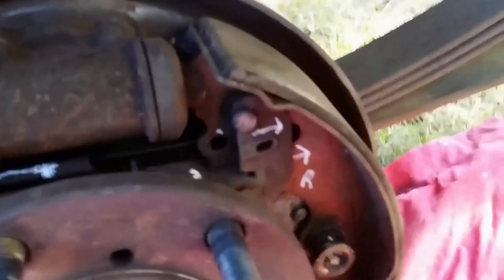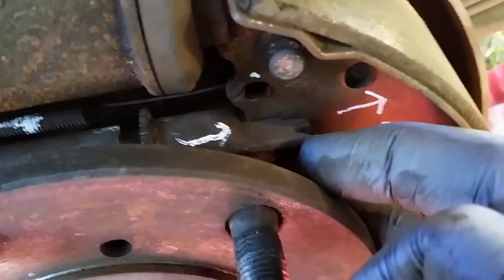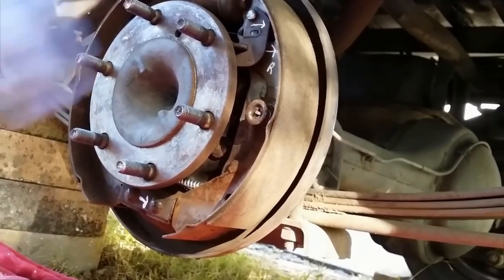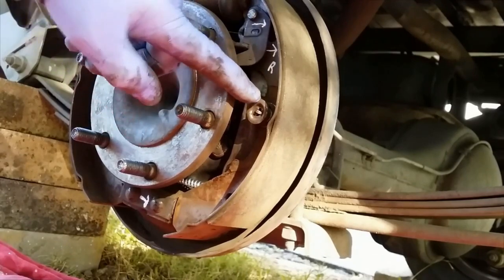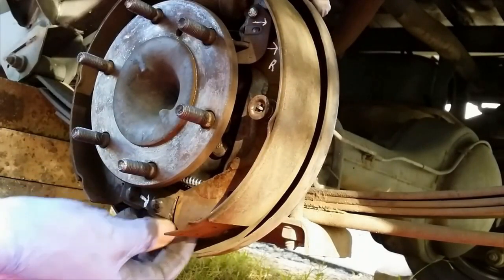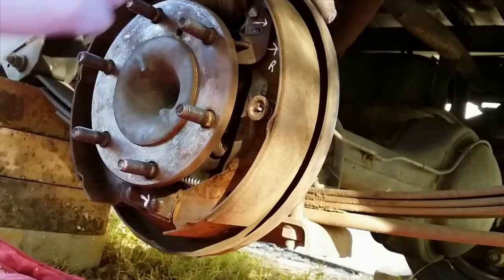With this small adjusting lever, you can just remove that. With this spacer, there has to be a notch facing out — that's what the spacer sits into, so it just sits in there like that. At this stage the shoe's on, the shoe holder's been put into place, and it still moves up and down a little bit but it's central. The shoe is sitting in the bottom retainer — I've got to put the bottom spring on and it's sitting in the top.